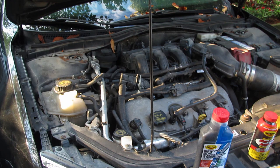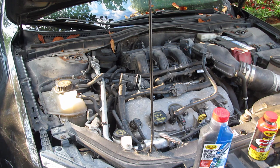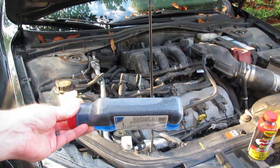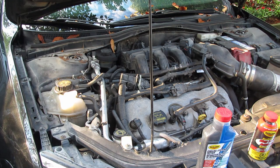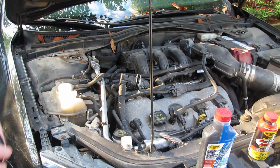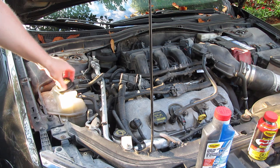The engine is still very warm. You're supposed to add it to a cool engine because there are little particles in there — this stuff will solidify. If you add it to a hot engine and don't run it, it'll actually clog up and do some serious damage. So I'm going to wait until tomorrow morning, simply take the cap off, shake the bottle, add it in, and then give you guys an honest update on whether it actually worked.